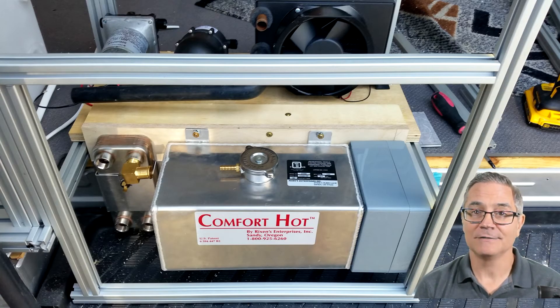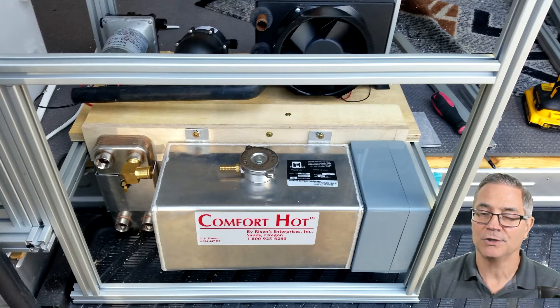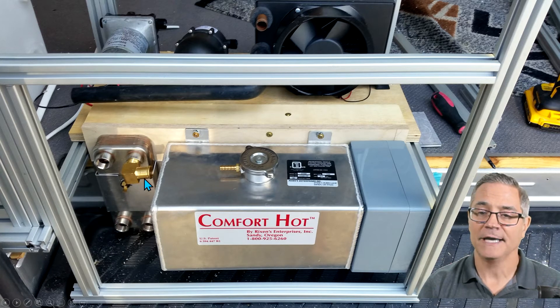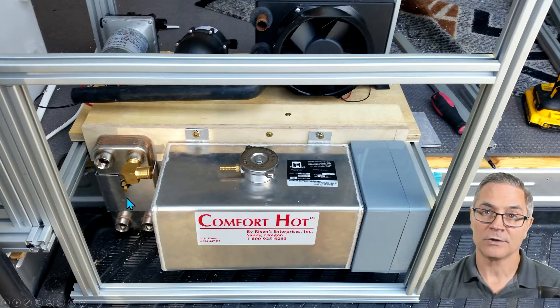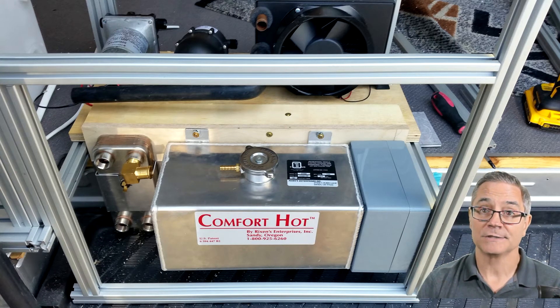One of the challenges when you build a van is where the heck do you put all this stuff? We're trying to compact everything into a very small space. I watched a lot of YouTube videos to see what people did and decided to do something a little bit different. One of the first things you've got to do is dry fit everything in. Your main components are your heat exchanger, your glycol tank, and your blower motor — and you have to consider how they all work together, realizing hot and cold water are going to be coming out of this, so you want your water supplies nearby. You also have to get the glycol back and forth to the furnace, which is underneath the van on the driver's side.